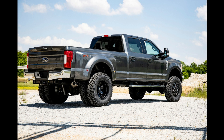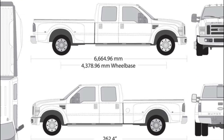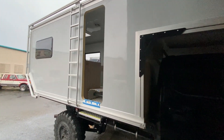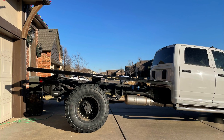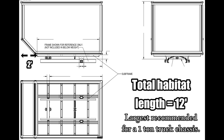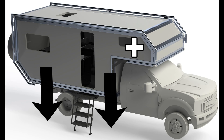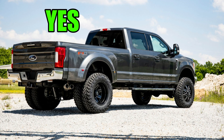Let's say you have an F350 Ford Dually, or equivalent Dodge or Chevy longbed. Let's say the available frame length is right around 8 feet, give or take, depending on the year, manufacturer, model, etc. Taking into consideration that there will be a small gap between the habitat and rear of the cab — at least 4 inches — the recommended subframe length will be 8 feet. This will cause the habitat to overhang the rear of the truck frame a few inches. You could choose a habitat base length of 10 feet with a 2-foot departure angle that cantilevers the rear 2 feet of the habitat over the subframe. However, a cabover addition could put the total gross weight of the vehicle close to maximum. Discretion must be applied since smaller vehicles' maximum gross weight is the biggest limiting factor when determining to use one for overland expeditions.